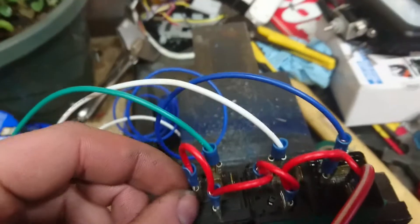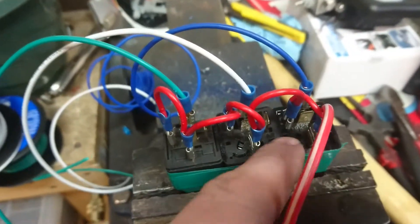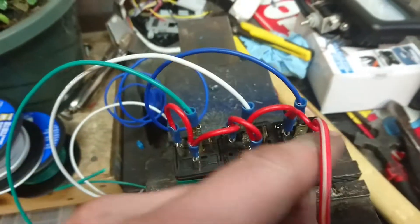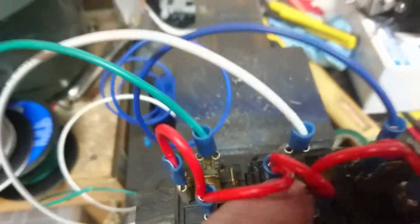How we fix this — as you can see here, we have number 30s on the bottom. I'm just saying number 30 because that's what your relay pin should be on the bottom. So 30, and all you're doing is putting positive to 30, which is right here, and 86.